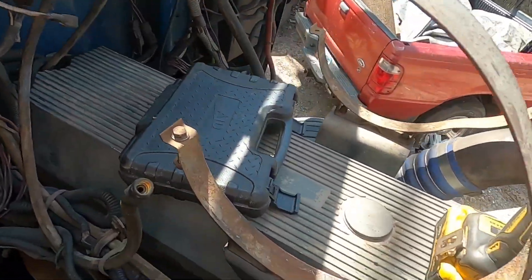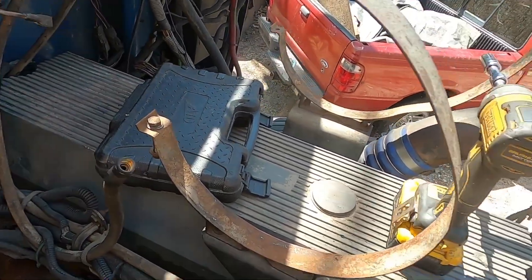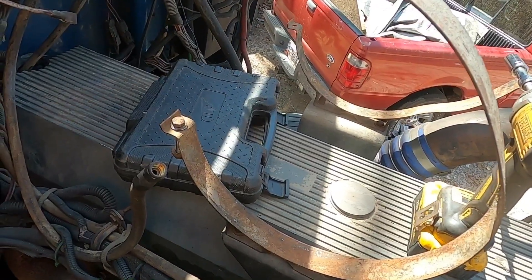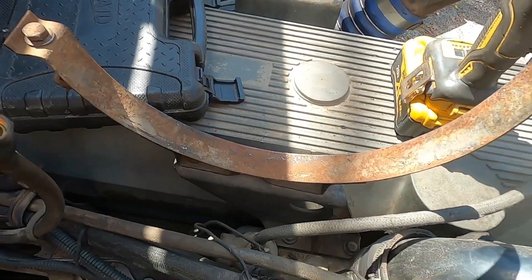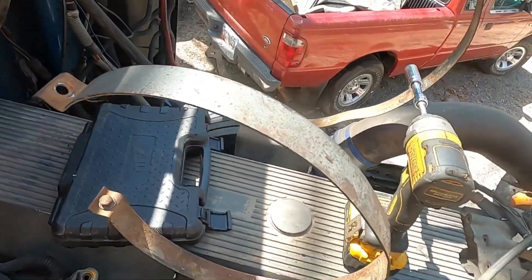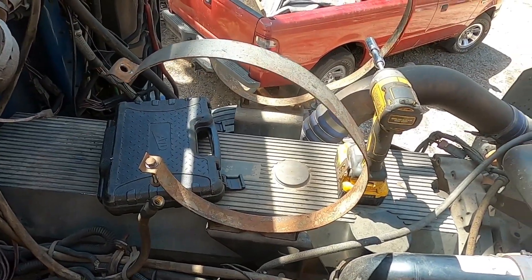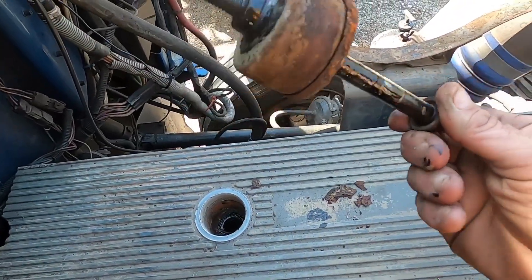In the back, just like the front, you're going to have a bolt back there. So there's only four bolts holding this whole valve cover on — it's more about getting to it than getting it off. Once you get those four bolts out, you might have to stick a pry bar or screwdriver down there to break the seal, because if it's been there for a while it's going to be a little stuck. If it hasn't been there for years, chances are you'll be able to just grab it and pull it up.